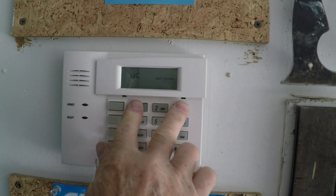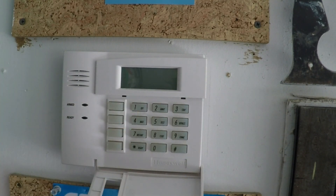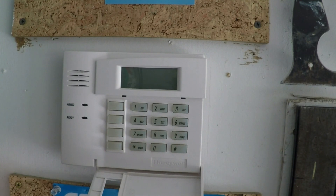Let's re-enable it. Hold 1 and 3 down to get back into User Mode. Select 1 to get key fob number 1. Select 1 to enable. Asterisk to accept. And, asterisk to exit User Mode. Let's try the fob again — and you can see it now works.